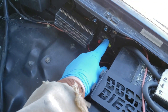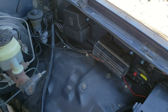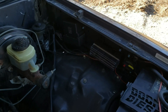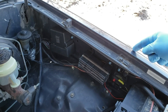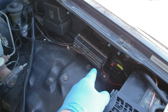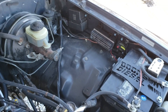This is the Doomsday wiring harness — it's a relay box for startup and shutdown. And this is the factory Mercedes glow plug controller. I installed some weld nuts with the fender off and welded those to the side, so some of these screws are using factory weld nuts but some I added. It cleans up the fender very nicely.